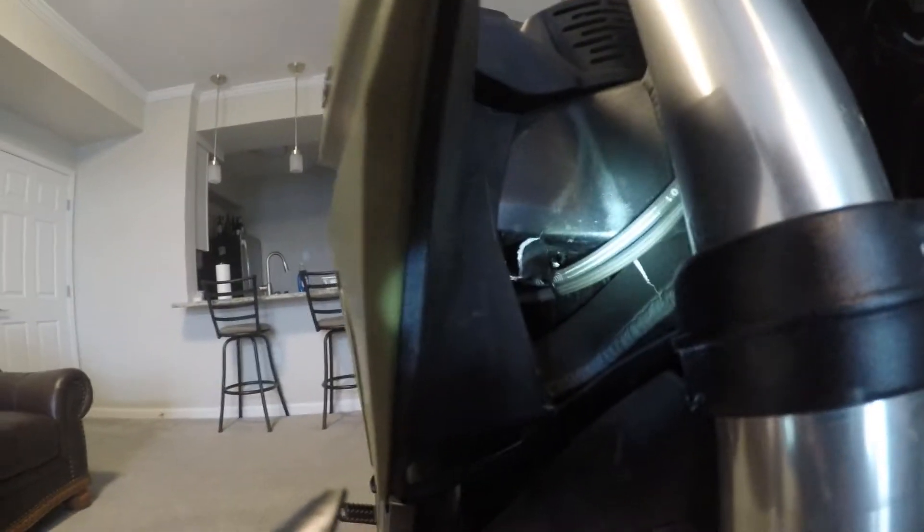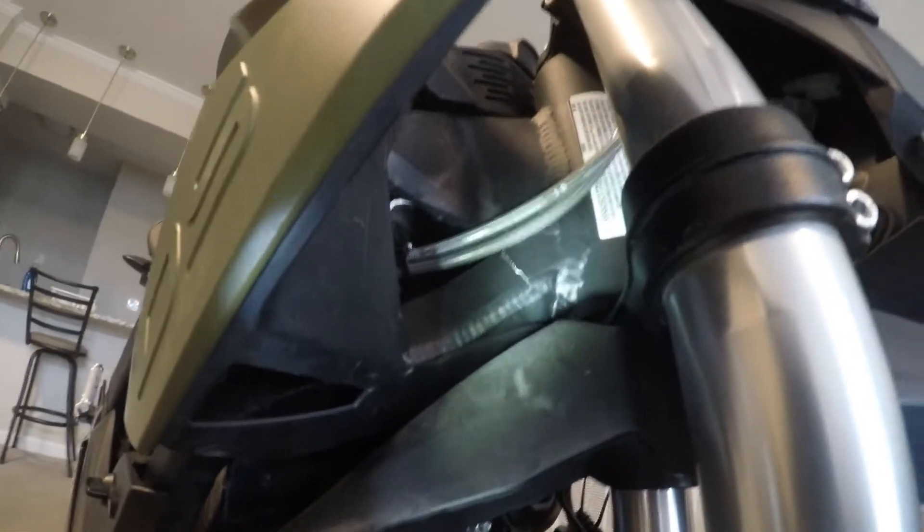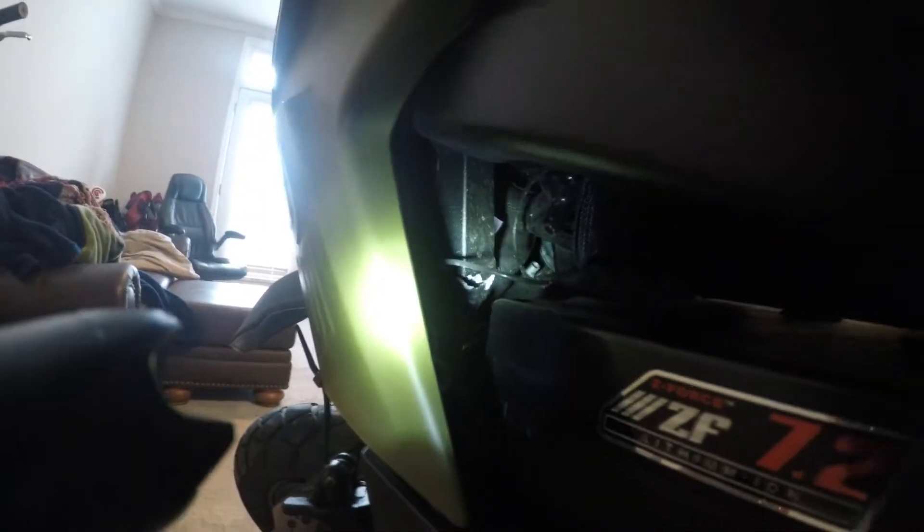So if the forks are straight and the wheel is bent, where did that force go? This is where it went - look right up in there guys, it's a cracked frame. I've been doing a lot of research and I see that a lot of these frames do crack. I don't know if the material they use isn't super strong or if it's poorly designed, but this is where they usually fracture - right where the neck meets up with the fork stem. We have a crack there, and also the force transferred along this frame member and met right there at the wheel - another crack along the seam, broke right on the wheel. I discovered a final area on the other side of the bike - also cracked right there.